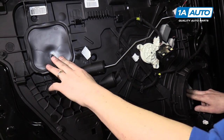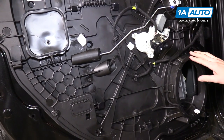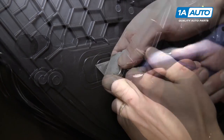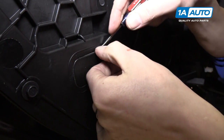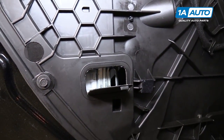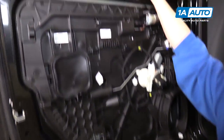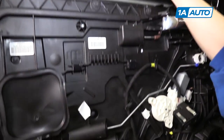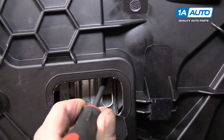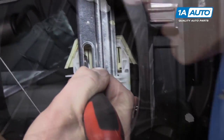If you were going up through the other panel, you'd have to disconnect it on the bottom and then roll the window up and disconnect it on this side. That presents some dangers because you may end up breaking some clips on the window, which you don't want to do. So we're going to knock this panel out. Now we can see the clips we need to disconnect right in there. While holding the glass with one hand or having a friend hold it, you're going to come in here and push on these little tabs on the glass. That will allow the glass to be raised up. This side is now disconnected. Now we have to do the same for the other side — just push the little tabs in.